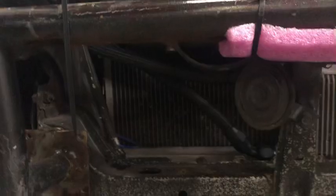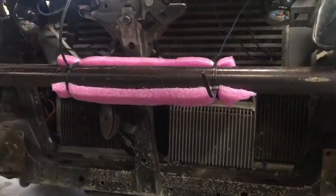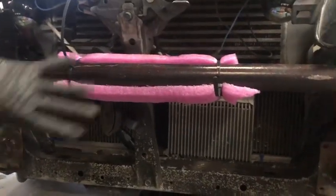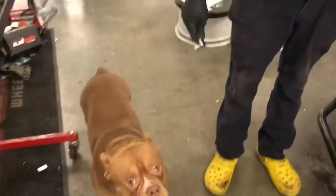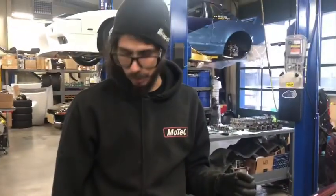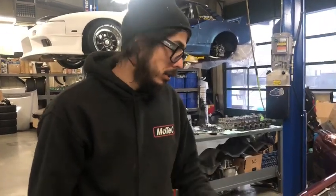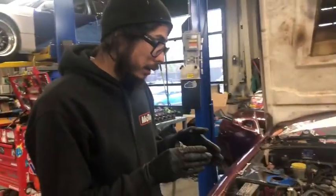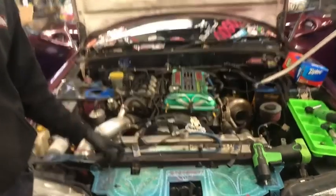And so whenever I do a sort of mid-mount like that, the radiator still has plenty of air to hit it. And obviously there's still enough room for me to have an oil cooler, obviously cooling the oil. And there's still enough room for the radiator to get air, not something bigger than the radiator to block it. I think the one in the S14 right now is a little bit taller and skinnier, so it might be just better to go back to using this one, which is probably what I'm gonna do.